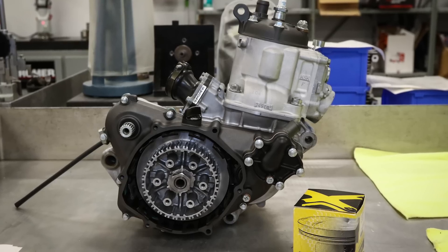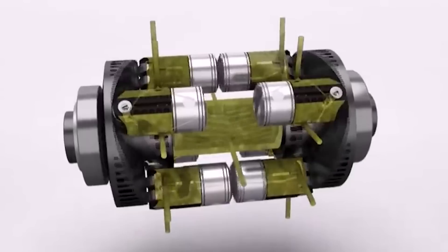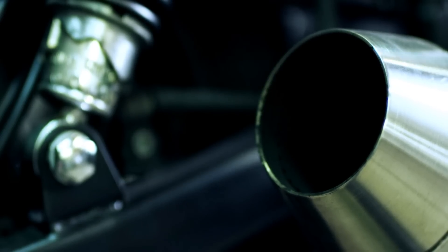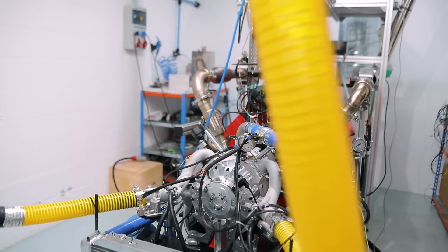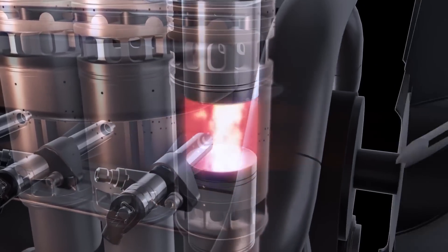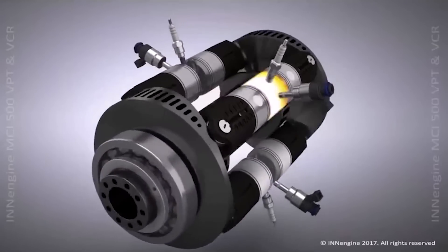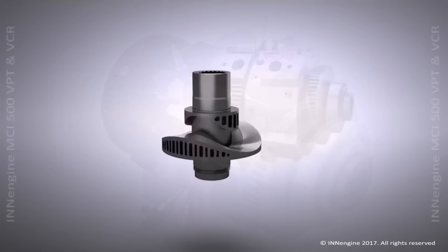Well, it's a marketing gimmick. More specifically, they say that they don't want people to think this is like a normal 2-stroke engine. This is because it doesn't burn oil during its use, which causes unwanted emissions in standard 2-stroke engines. I understand they wanted to stand out here, and maybe we would have never heard about this interesting engine at all if they had called it a 2-stroke engine. But it is very similar to a diesel 2-stroke opposed piston engine, just with an ignition system for the fuel, separate lubricating oil, and the swash plates.